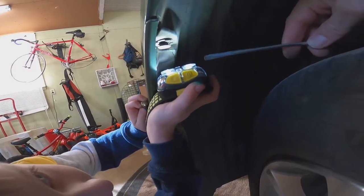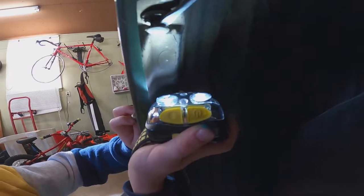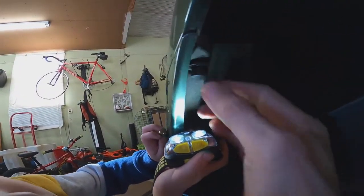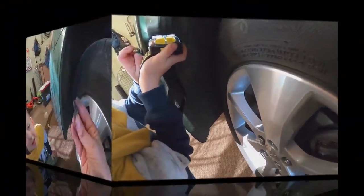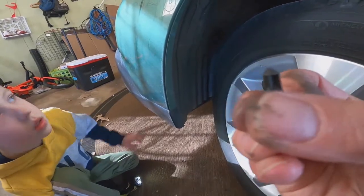Move that light down just a little bit. This is how you remove it - you take a screwdriver, stick it up there on that clip, pry down the middle just a little bit, and then pull it down. Keep working it, it's going to pop out. A tool like this really comes in handy. There we go - got it out. Look real close, you can see how it slips in and out. It's two pieces that popped open.